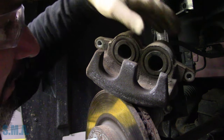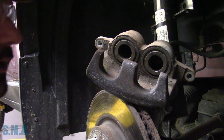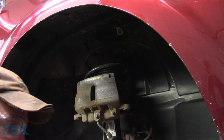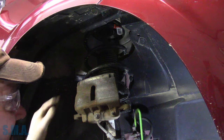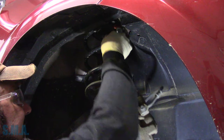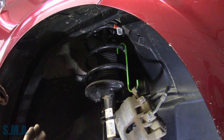Looks like phenolic pistons — plastic. We'll stick the caliper up on the strut and grab a hook, because if we don't, the inevitable will happen — it will fall down and smash my finger. So we're going to give her the old hooky. Keep that right out of the way because I imagine this rotor is going to come off kind of hard.